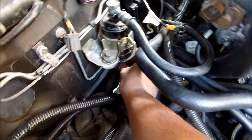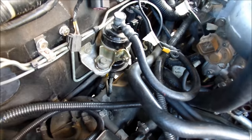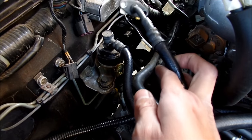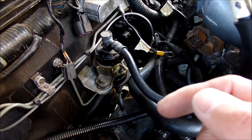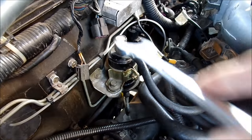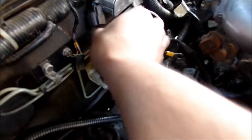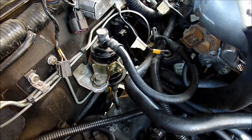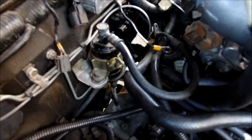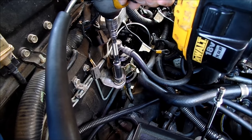Go ahead and loosen this all the way. It's loose — yeah, it's not connected tightly. I'm assuming this has been changed not too long ago, but better safe than sorry. Now it's free from the bottom line and the top line isn't connected to anything, so it'll come right out. You can get whatever size this is — I think it's three-quarter or 19 millimeter — and loosen the banjo bolt to take it out. I think this bracket bolt is a 12 millimeter. I got my impact driver and wow, that came off way too easy.